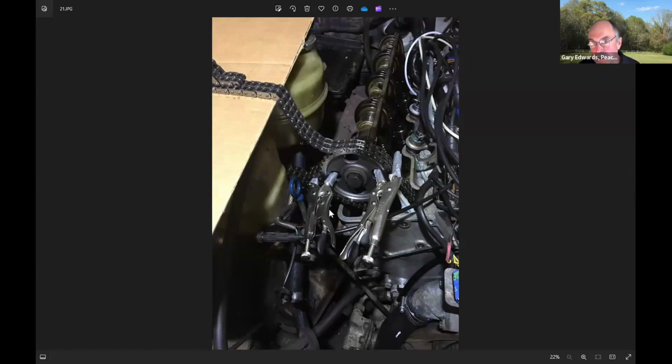I did this with 3 very small vice grips. I taped the jaws to pad them and rotated the engine. When I got to where I couldn't rotate anymore, I put the other vice grip in, remove that one, rotate another third of a rotation, and then swap them again. You draw the new chain in and pull the old chain off.